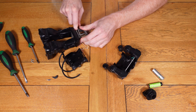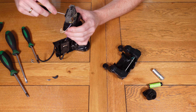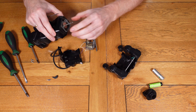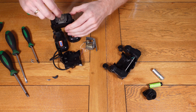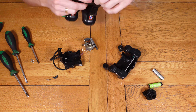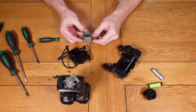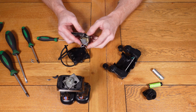The stiffness might have even been the original issue that then caused the wire to mess up and chew up inside. I've now removed the main part of the metal mechanism to have a look inside, make sure the cogs look okay, and confirm it's operating as it should before putting it back together. When I operate the cog in the lower section it moves the legs correctly, so this is all okay.